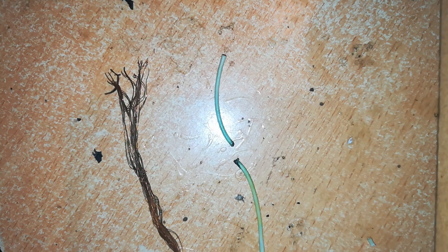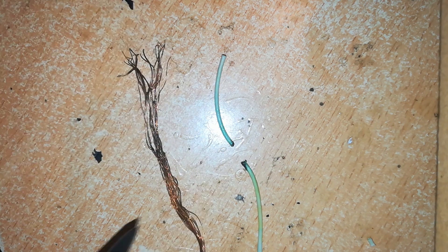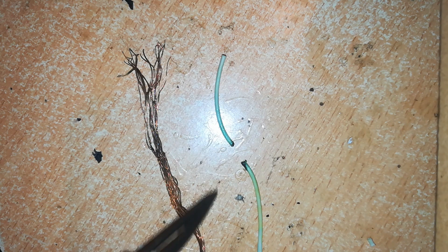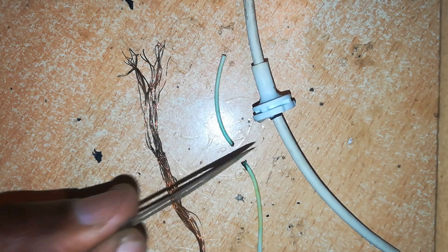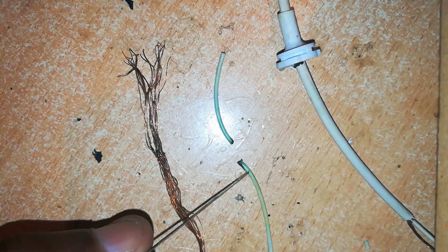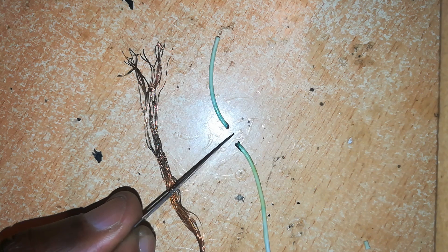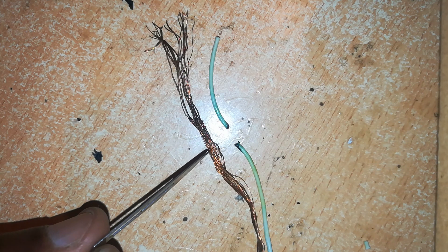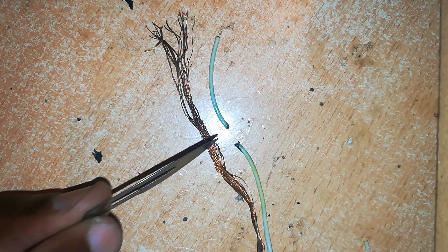There was a break in the cable and this is what was causing the malfunction. This is the problem with these replacement cables — they are not durable at the junction where the cable meets the adapter. At that point there is a lot of strain and heat, and this is what happens: the insulation breaks down, the wire is exposed, and these shorts are dangerous to your laptop. When using replacement cables, you should be careful about this.